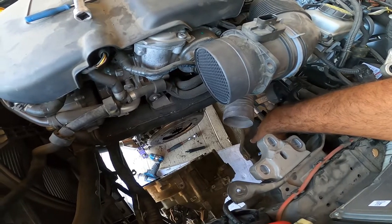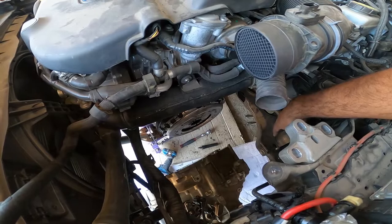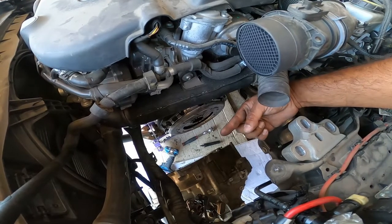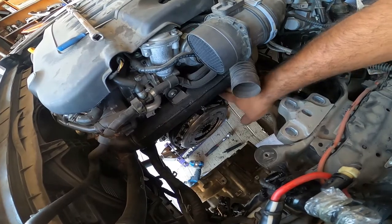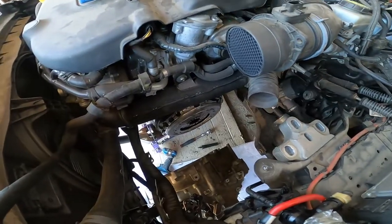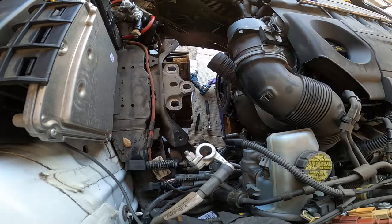It shouldn't take that long, but just giving you a heads up, when you guys get it up over to this point, remember, you have to clock it counterclockwise to get it over the hump and behind the actual transmission, and then clock it back down, and it should fall right into place. Again, should. We'll see what happens right now. All right, here we go.